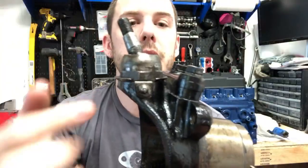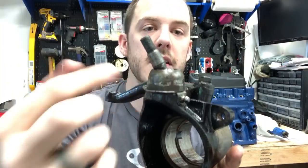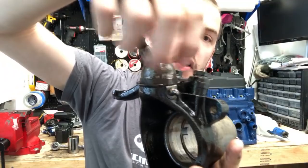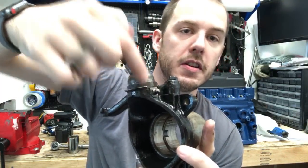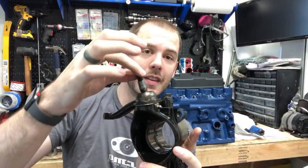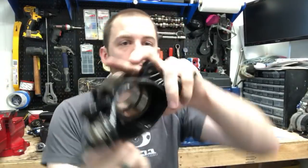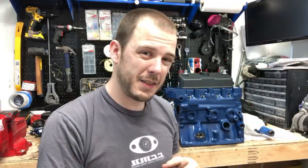All right, so I'm just going to hold this up again. This right here is your lock washer, and that gets hammered up to keep this from spinning when it's on the car and in operation. But this whole piece right here comes off, and in between this nut and that washer, the shim is used to create just the right amount of resistance on this pivot joint right up here. So this one, too loose. This one, thumb tight, which is what you want. Does that answer the question?